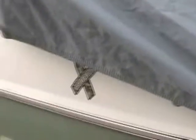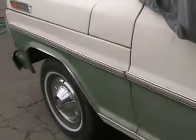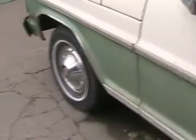Let's see if this old truck's gonna start. The first step to adjust the Ford carburetor — any carburetor for that matter — we have to let the motor start up and run for a good while: let the oil heat up, let everything else heat up, let the choke crack open and everything on the carburetor.